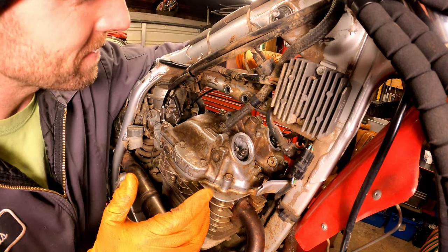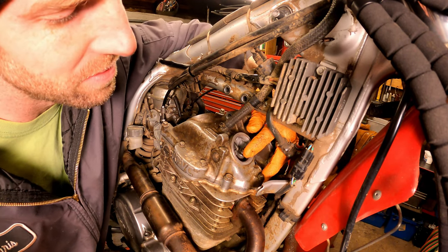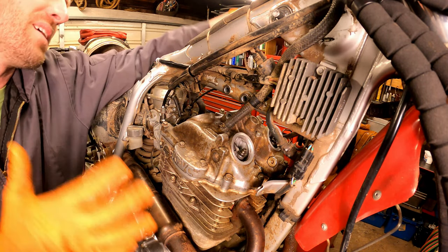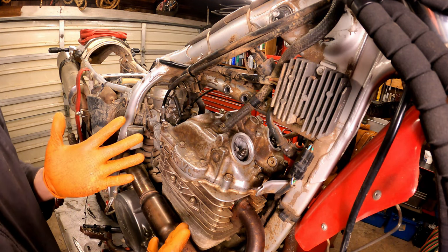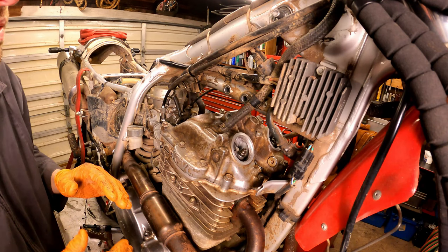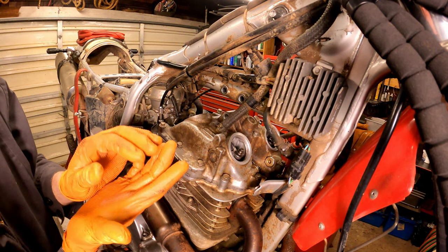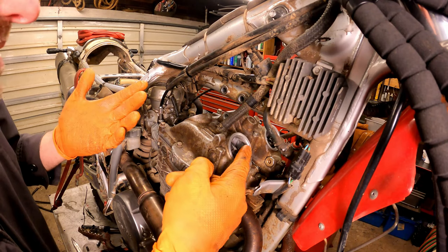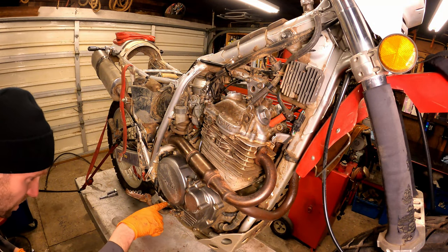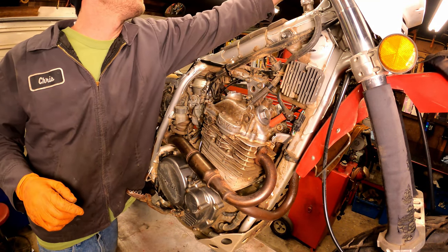I think I found his noise problem. I went to adjust the valves — it gets four thousandths clearance on the intake and five on the exhaust — and these were all good except for one. You can actually see how high the screw is on this one too. I should have checked for this in the beginning, but seeing as how he had a broken rocker arm I definitely wanted to inspect the cam first. I'm thinking he probably adjusted this when the decompressor was in the activated state. I know Dave's no dummy so I'll get that tweaked in — moment of truth. I also made sure to check the oil level in the crankcase; the frame's empty but that's normal when they sit for a while.